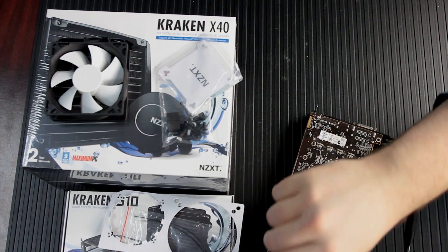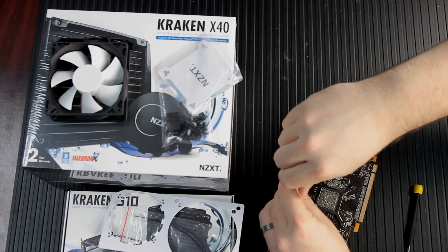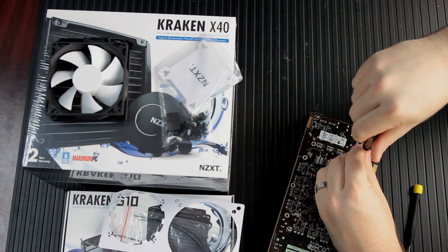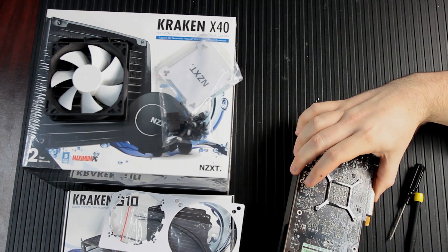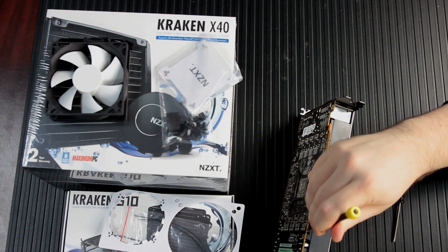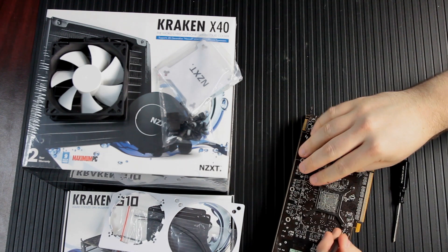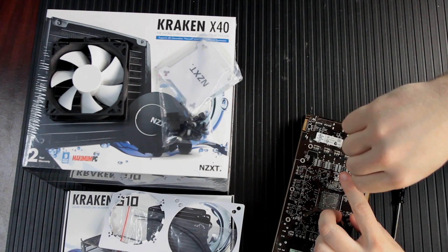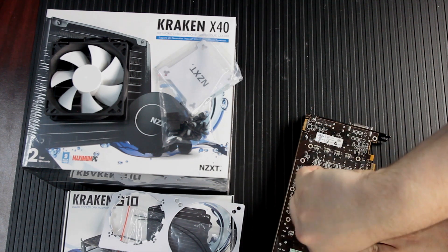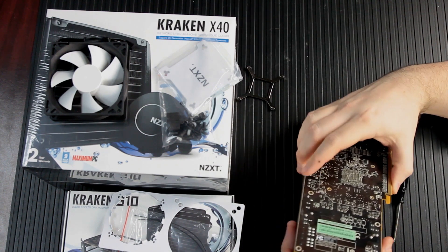In our case we're looking at an AMD graphics card. There are screws for the shroud coming out now, and there are also screws on the small square adapter plate for the cooler mounted on the GPU chip itself. One thing that's important: with certain GPU manufacturers, this upgrade does void the warranty when you take off the shroud and the cooler. There may be stickers over some screws — look for that before you start and before you go buy stuff, if you're not comfortable voiding the warranty.